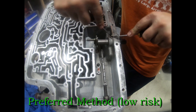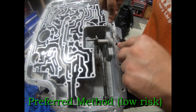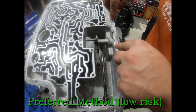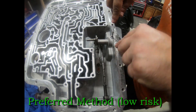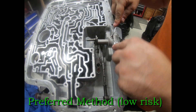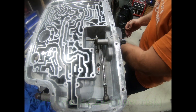You'll have to feel around a little bit. You'll get to a setup where it's just going to start grabbing — it's usually the edge of the roll pin where the edge of the steel folds around. You can see it's starting to come up; just keep going, and you get to a point where you can just grab it with your fingers. That's one way to get it out.